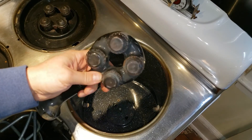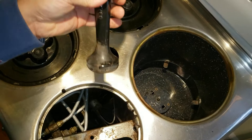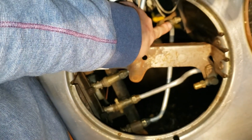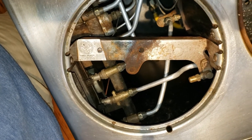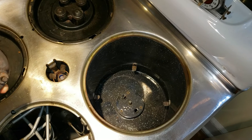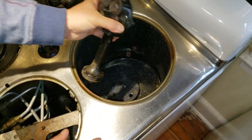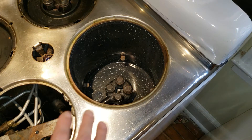The next thing you want to do is install your thermal well burner. The thermal well burner has a hole on one end that fits into a jet — you can see it if you look through the front right burner. That jet down there is the thermal well jet. If you've never done this before and want to be absolutely sure everything's lined up right, install that front right burner last so that you can see. It really just slips right in. There are two tabs on the bottom to make sure it locks into place properly. If you look down around the pilot, see that little circle in the middle with two holes in it — these tabs lock right into those holes so your burner won't slip. You bend in, poke it through the hole, make sure those two tabs sit nice and tight so it's not wobbling.